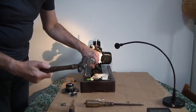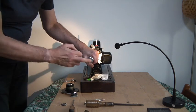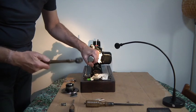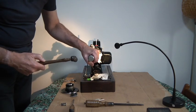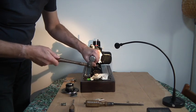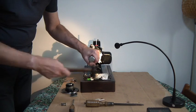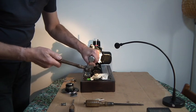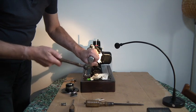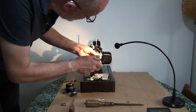And with a light hammer, not a big heavy one because you don't want to damage it. This impact screwdriver will take almost any size of hammer, but you have to scale it down because you're using smaller bolts. And all you do is you firm everything up so you're like one big spring going that way, and you strike, and that's gone already actually. Two hits, come away.